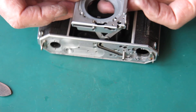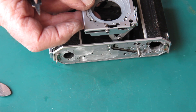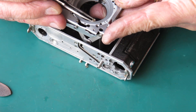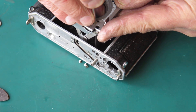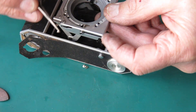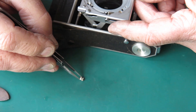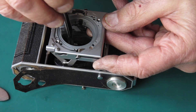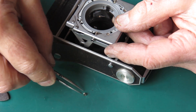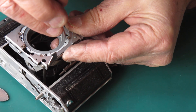The focus mount should just go in here, and I should have four nickel-plated screws to hold that onto the front standard. Now, I'm supporting this with my finger underneath both to hold it in position and so that I'm not pushing down on those struts and bending them while I'm pushing on the screwdriver. All right, they're all in position — I'll tighten those four up.